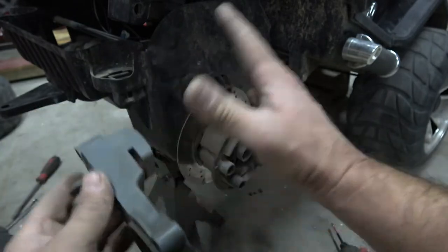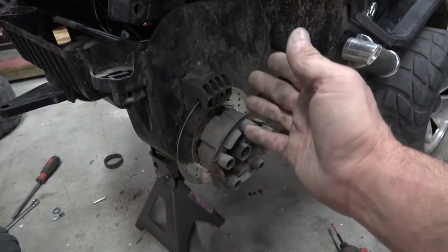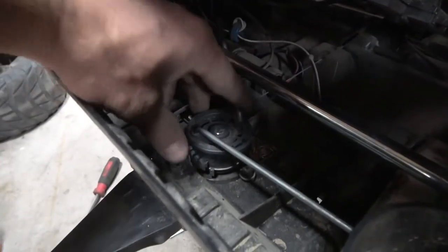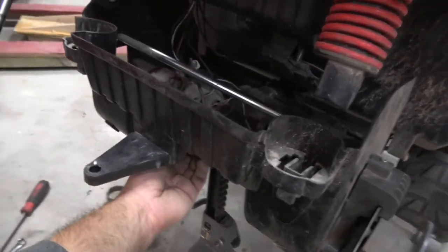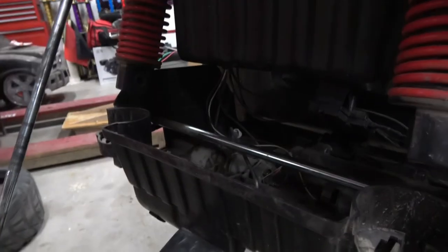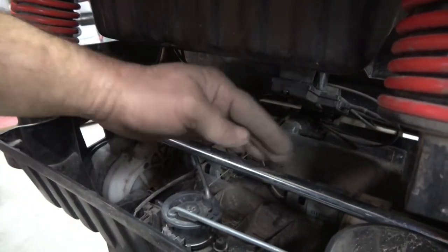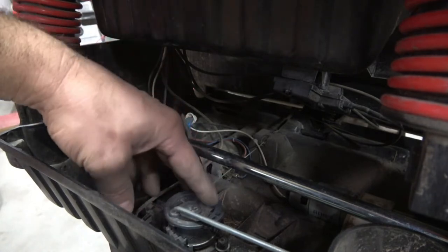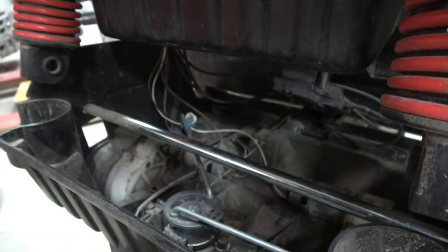That was the first fix. I did the passenger side, put it in and it worked, but it wasn't quite locking up. So the next thing you've got to do — because the pad wore and it changes the leverage — you have to go in here. This little mechanism right here, when you pull the brake it turns. You have to loosen the nut on the bottom and clock this over one more tooth. As the pads wear it changes where the lever is. I turned it clockwise facing down so that it pulls the arm out more and puts the pad closer.